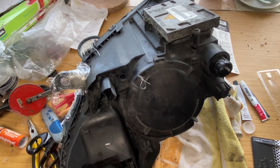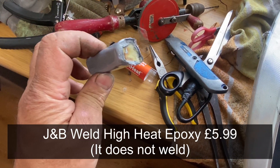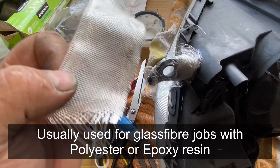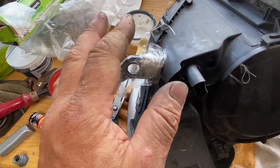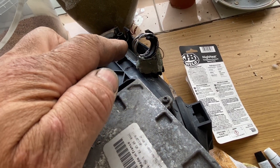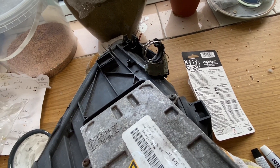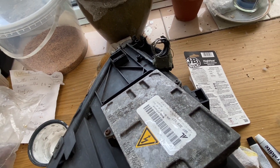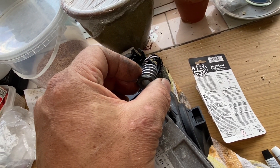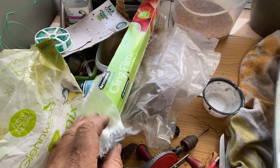So fixing up my headlamp — I finally got the front bumper off and found a few problems. One had a crack in it, so I've put some JB high heat epoxy paste in there. The crack was only slight, but I thought I'd better reinforce it, and I've used a little bit of bi-directional glass fibre weave mat just to make sure it's strong and never cracks through. This one is actually half missing, so I've got some stainless steel welding wire for my MIG welder and made rings, linking it in, and I'll use the JB paste again to reinforce and build it up. I've put some grease on the headlamp adjuster before sticking it in, hoping it will still be adjustable. I'll try using a bit of cling film on it just to make sure.